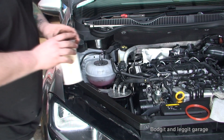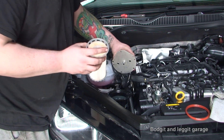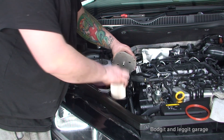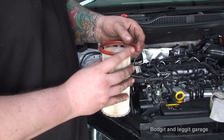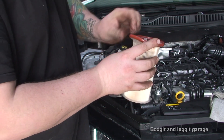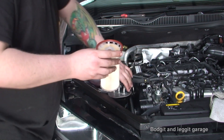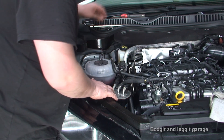If it fits, we're not going to have a problem. I've drained the diesel out, sucked it all out and cleaned it to make sure there's no crap in it — and there we go, it fits. What you do have to do is make sure you put the O-ring on. It sits on top of / in between the filter. That is important because if you don't, it won't seal properly and it will draw air.